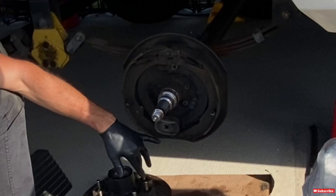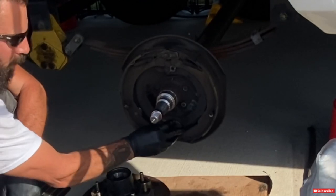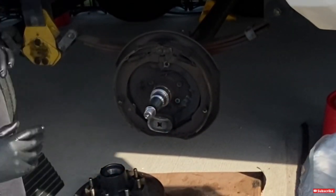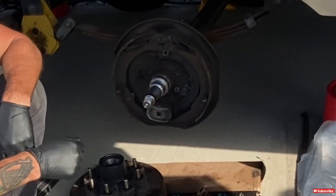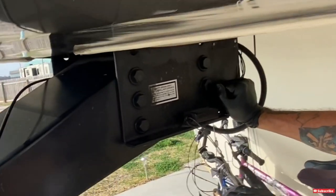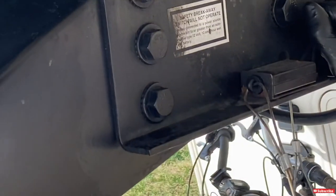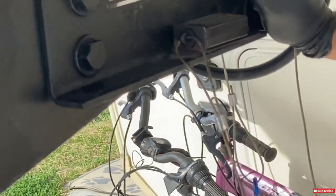There's a magnet right here — when you hit your brake, this activates the magnet, which sucks in and pushes your brake shoes out to stop the drum from spinning. A quick way to test that all the wiring is working is to go pull your emergency breakaway cable. Just pull the cable out and spin any tire that's jacked up in the air — it should stop it right away, and you know your breakaway cable is working.